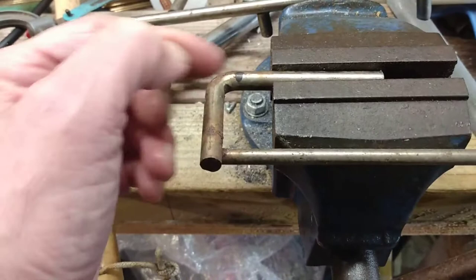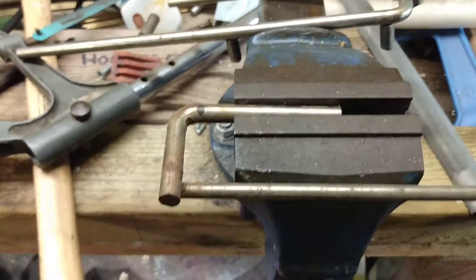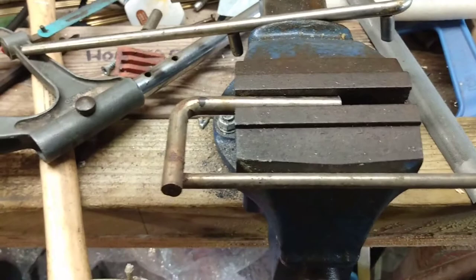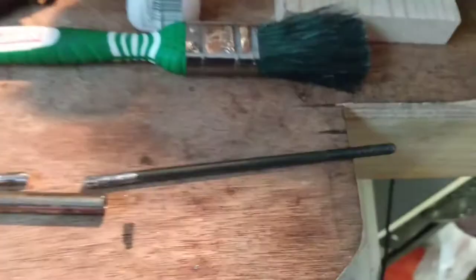I'm going to do it a slightly different way, which I'll show you later. I'll need to turn it down so it's a small enough diameter to fit inside the axle — it's too big by only a couple of millimeters. Here's the bar stock — an old bit of oven grill. There's the original skewer, now cut in two, and there's the extension piece.